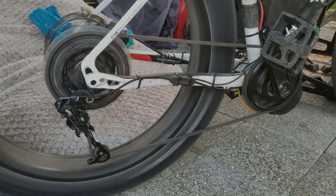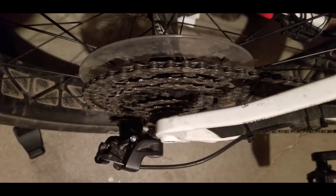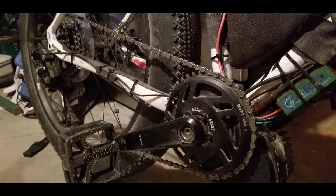Looking longer term, I still want to switch out and just have a single gear without all the other stuff in there — maybe use a more heavy-duty chain and just a chain tensioner. I think I can probably just use a heavy-duty chain as it stands and I'll try that once the current one wears out. Another option would be to use a 36-tooth gear on the front driving a smaller gear on the back, still getting the one-to-one gear ratio that seems to work really well here.